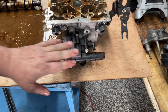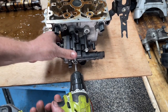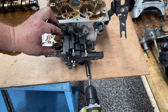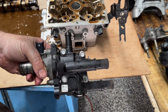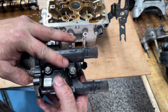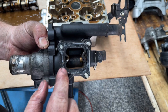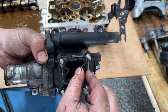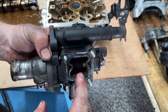On this end here, I'm just going to take off this thermostat housing. This will be thrown away — we'll buy a new one. Typically these are cracked and broken and the source of the leak anyway. Looking at this gasket in here, we can see that the gasket has swollen up, which is a pretty good indication that there's been oil in the cooling system.